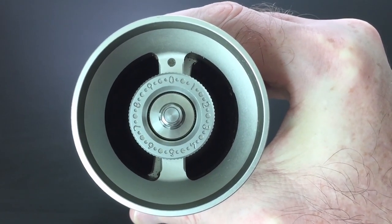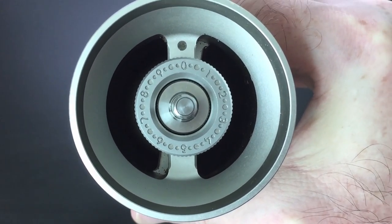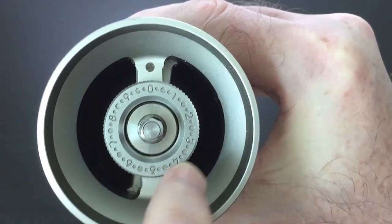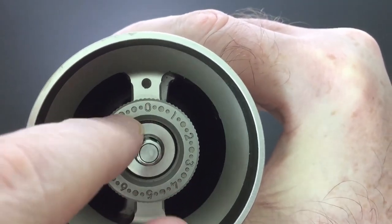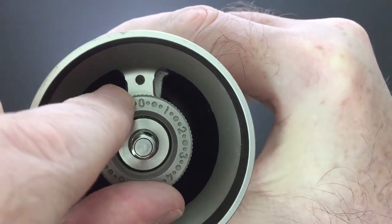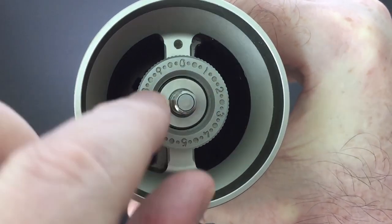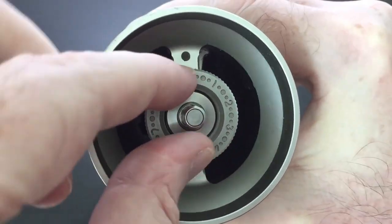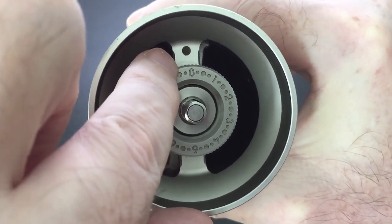1Zpresso, a while ago, did update their information on the website regarding how to do this. In their method, you need to take the adjustment dial off and adjust the thumb nut underneath a few clicks to bring the number around, wherever that number lands in the starting position, until you get the zero into the starting position to calibrate it.